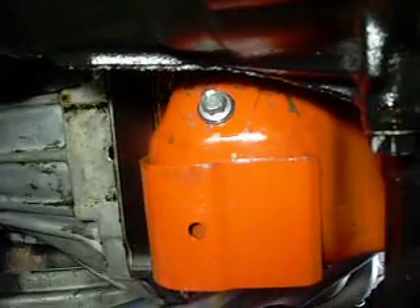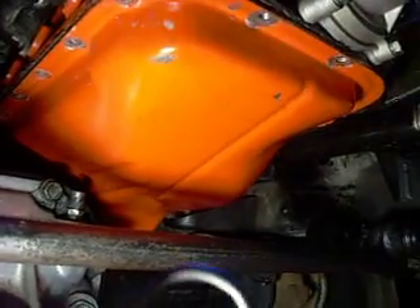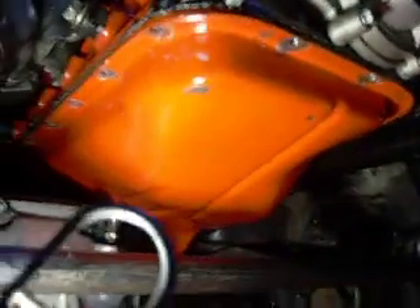That's another thing — I was looking at the oil pan. I think it has to come out, because I can't see any way to clean so many parts of it, like around the edges. There's no way to get in there. Even if I dropped it an inch, it's going to hit the diff — it can only drop so far. I guess it could drop at an angle, but I'm not sure. I think it would be smart just to take it out if I can. Obviously I don't want to lift the whole motor up.